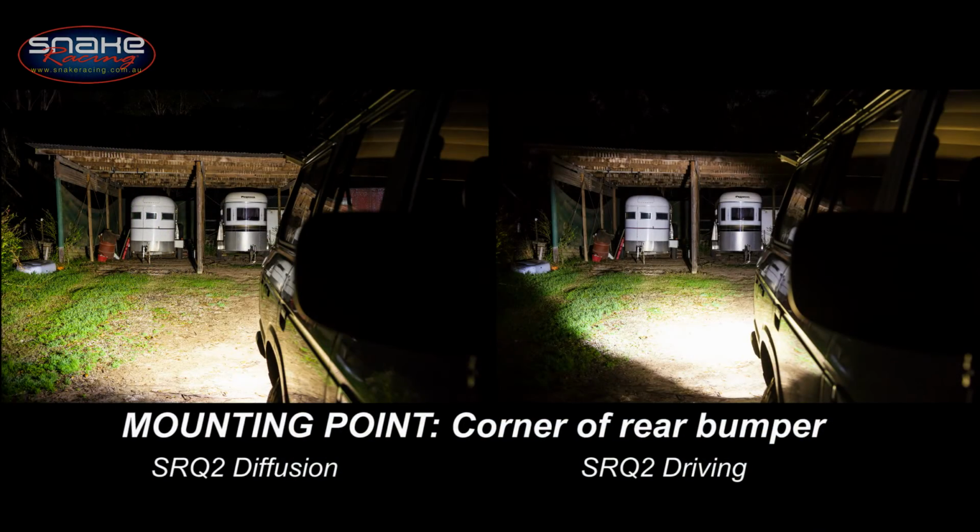First up, down low on the corner of the rear bumper. While both lights look much better here, the driving pattern on the right is really creating a nasty hotspot on the ground which may dazzle some drivers, proving that there is such a thing as too much light. The diffusion pattern on the left does a much better job, as you would expect from an ultra-wide beam pattern.